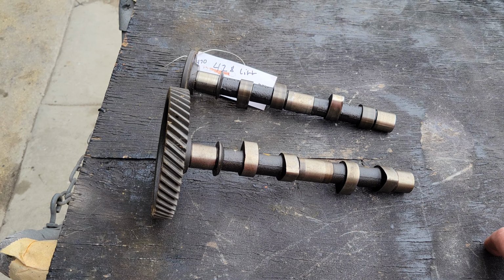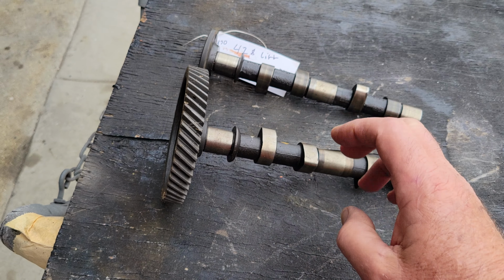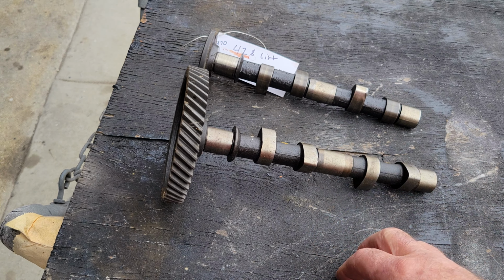The reason is that all that spring pressure is going to beat up your valve train. The same thing goes for running a straight cut gear set. If you're thinking it just sounds cool, I want to put on a straight cut gear set, what happens is that vibration will cause tons of wear all over your engine that's unnecessary for the street. So it's better to run the ones like this here, because they do less wear in the engine. You need to run straight cut gears when you have too large of a cam and it's putting a lot of pressure on your thrust bearing.